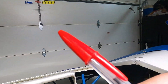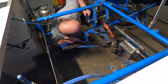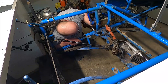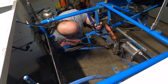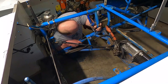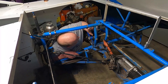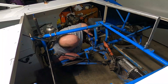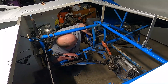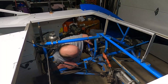That's confirmed — it is cracked all the way through, even on the front side. It looks like somebody tried to fix it here and the weld just didn't take. They didn't get it hot enough. It just beaded up on top. That's what that line is that I saw yesterday.